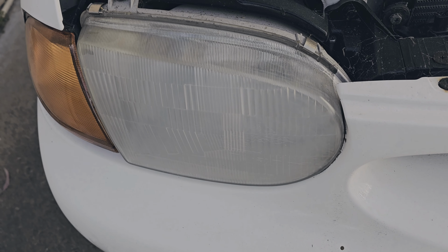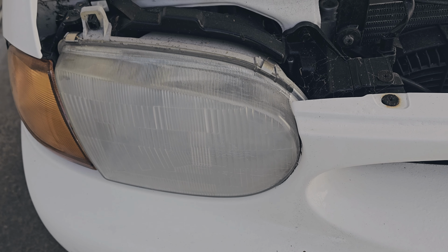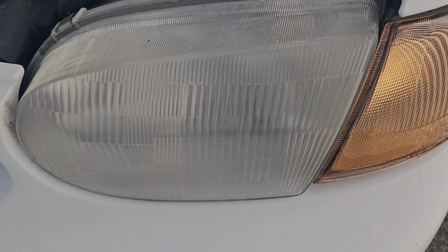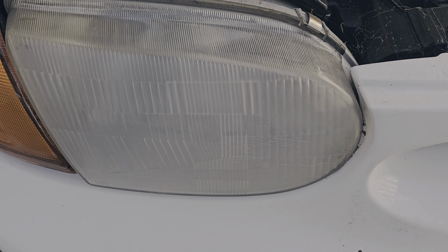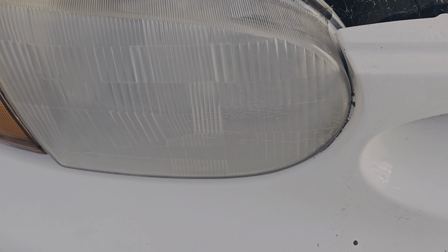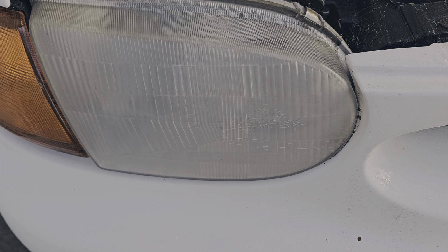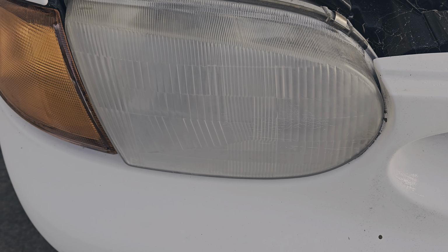That is not very clear looking because I'm only using 2000 grit sandpaper, but that is very polished. Now take a look at the before. As you can see, that looks pretty faded. But if we take a look at the after, that looks pretty clear. All I need is some 3000 grit sandpaper to finish the job, and I should be good. On to the next, shall we?